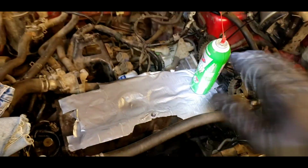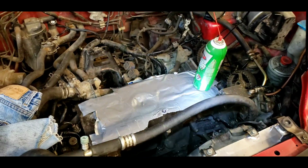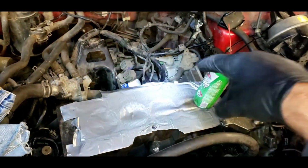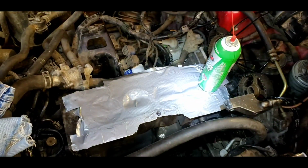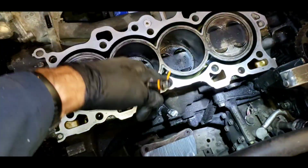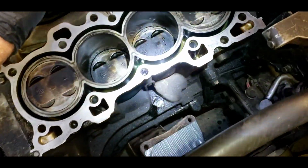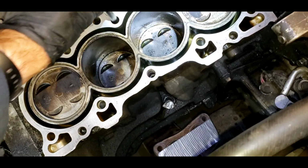So the next thing to do is to clean up and put the head on and see if it torques. That's going to be the test. And if any other ones are loose, I can do the same. I feel a little more confident now. That's a little nerve-wracking. So the two center bolt holes are raised. They're a longer bolt. And I'm going to check, see how equal they are.